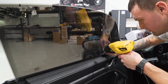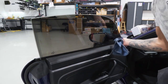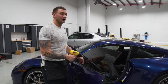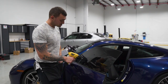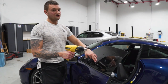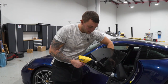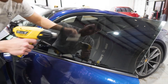A little advice for these windows: if you have an infrared heat lamp, use it. If not, sit outside with the heat gun for about five minutes heating the lower edge of the roll-down window, just to make sure that any fingers that could potentially pop up after the customer leaves are down and stuck. Because if they aren't and the customer opens the door with the fingers up, it'll end up peeling and you'll have to completely redo the window.